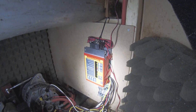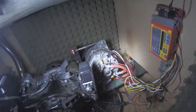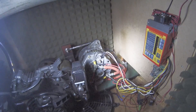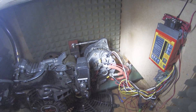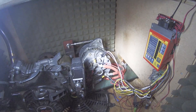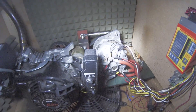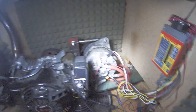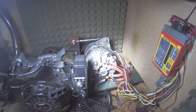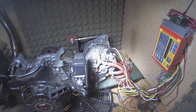It's a little bit expensive and I didn't really need it — the internal regulator would have worked fine. I bought it while troubleshooting because I was getting 18 or 19 volts out, which was boiling the batteries. The problem turned out to be one of the field winding wires snagging against the alternator chassis, giving it full power the whole time — just a mistake from whoever rebuilt it. I bought it rebuilt off eBay — standard classic eBay jokery.